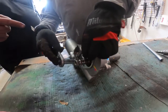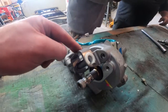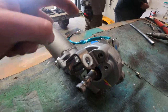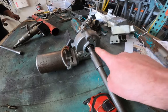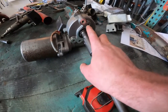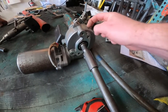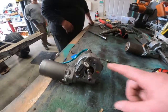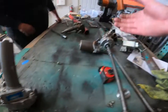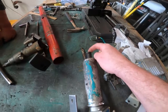We're taking the bolts out for this bracket that is required for the OEM installation — we are not putting the bolts back into this bracket, they're not necessary. Our mock-up here that we've already done, we don't need it. The tube's going to go right here. If we use any bolts it'll be these two, but remember — not too long. They don't want to go into that gear. Once we get that bracket off, this motor is ready to be mocked up. We're going to weld here and weld the other shaft in, and then bolt it back into the truck.